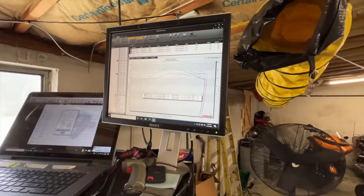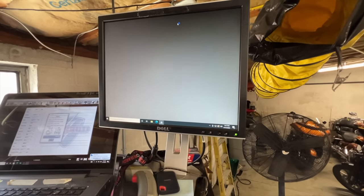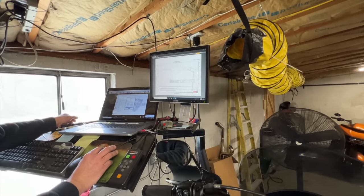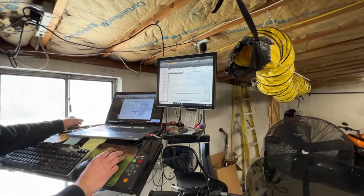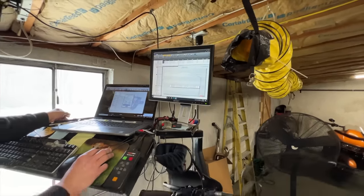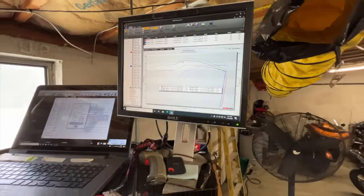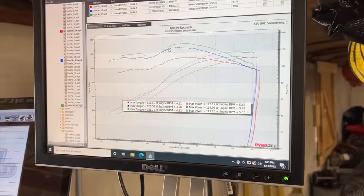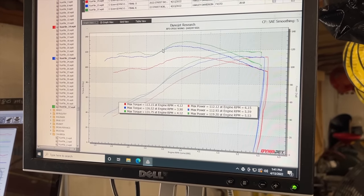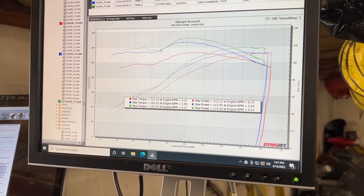You want me to print this? Sure, print this, please. Then I will show you an overlay with three bikes with the 22XE, which I think is very interesting, and with different exhaust systems. And altogether, while tuning the 22XE, I didn't have any trouble with timing, with having to pull lots of timing out for detonation, which is great. It's a very easy cam to work with. It's safe. And the 475 doesn't have many bad characteristics or side effects like that either.